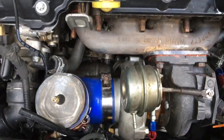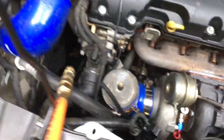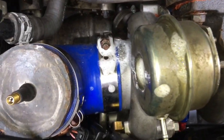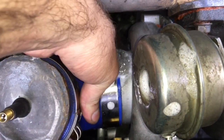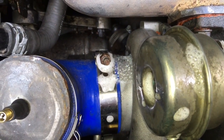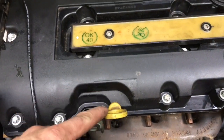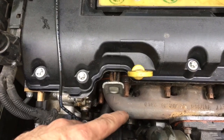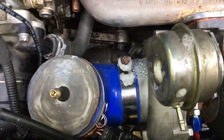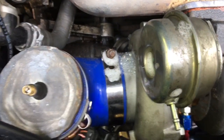We're just crossing 20 seconds and I still have pressure. We're at about 45 seconds and still have really good pressure. Keep in mind it is leaking a little right here — the places this will naturally leak during a test are past the valves in the head, out through the exhaust system a little bit, and down through the piston ring seals back to the crankcase ventilation, but it should be very minimal.